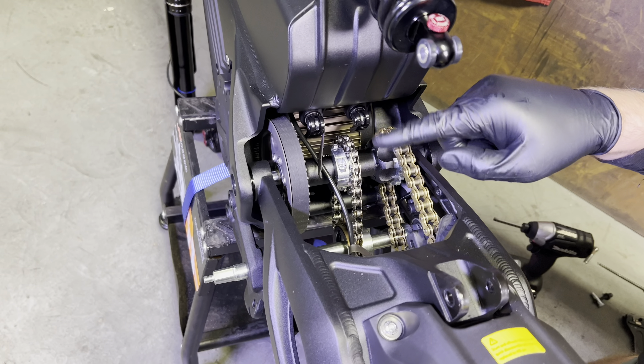Now it's time to reinstall the rear shock. It's very important to secure the rear brake hose from making contact with this cog — you also want to be sure it doesn't make contact with the belt. Using that little wire strap that Talaria provided, they recommend you wrap it around the quick release, and it's going to hold your rear brake hose free of the belt and the small cog. They also include a few zip ties — you can throw those on here for a little extra peace of mind.